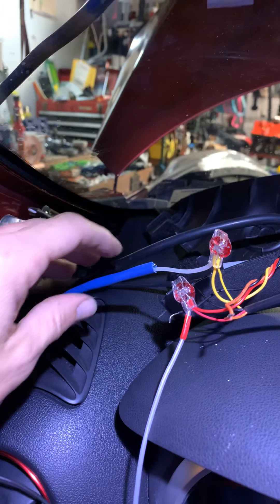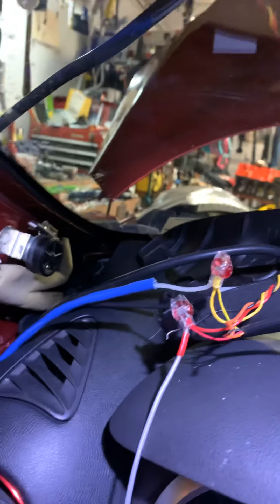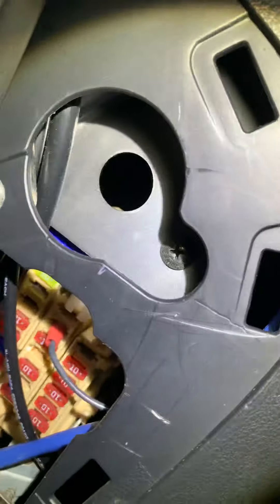I'm going to send that directly to the battery where I have a relay set up for my fog light. It's already run all the way down — goes through the hole, goes down here. Fed it in by the pillar, felt around, snatched it over here. You can see it makes a pass right through there. You can feel around, comes down, and I sent it down through a hole in the bottom — you can see it comes out on my floor space right there.